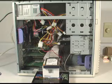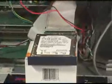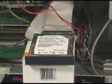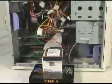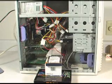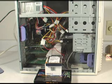Here we have our laptop drive installed in the machine. The drive is set up with an adapter on the IDE cable, configured as the slave. The C drive for the machine will continue to be the primary drive that we boot off of — we just hook it up as a second hard drive. Make sure to check the BIOS settings so that the slave drive is recognized, as it can sometimes be configured to be disabled. We want to make sure the slave is enabled.